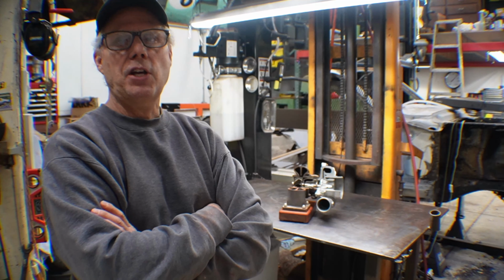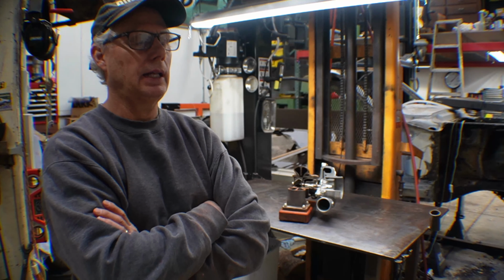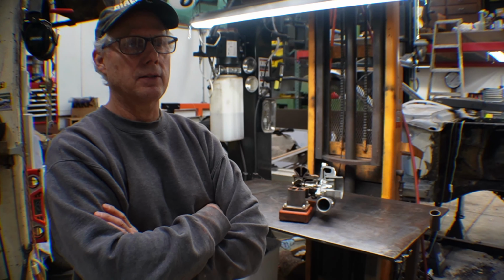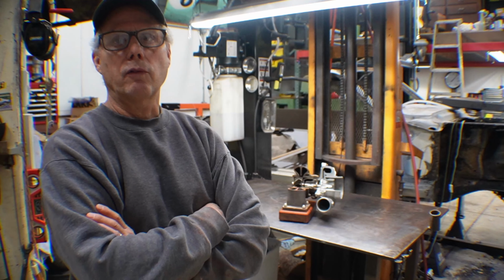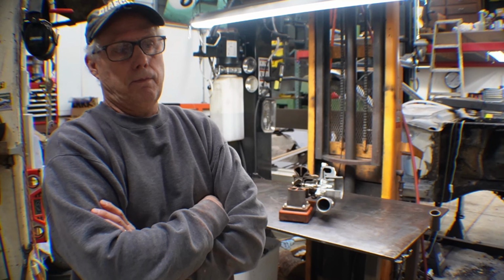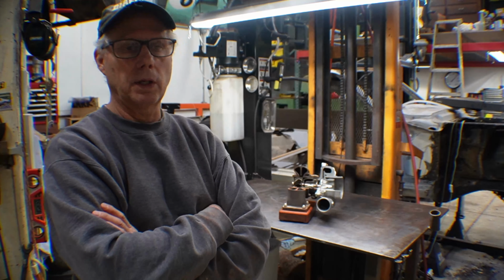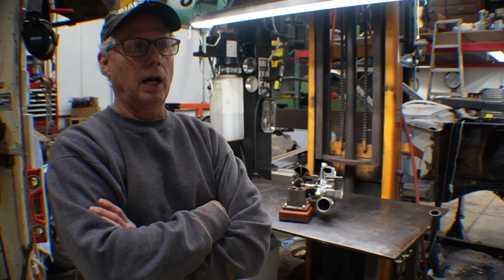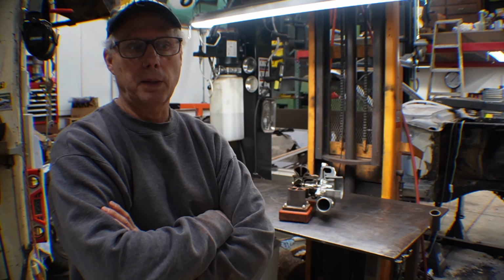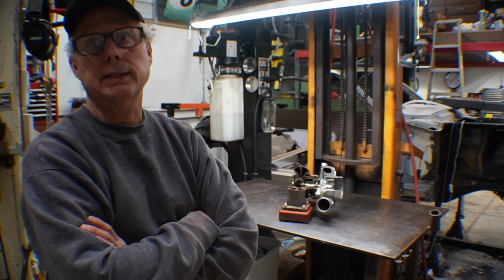And it's a challenging time right now with turbos because all the new technology in the aftermarket turbo world is coming from diesels, right? It's diesel technology that's being carried over into the automotive aftermarket. And diesels, you know, it's lots of boost, right? You can't put too much boost into a diesel. So, you know, 30, 40, 50 PSI is very common for a diesel, like a standard production diesel pickup truck has 30 PSI. It just does. And even ones 20 years ago had 25 PSI.